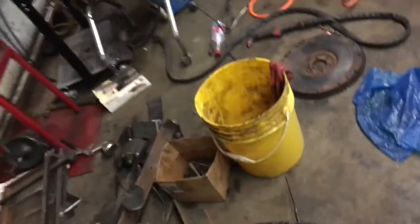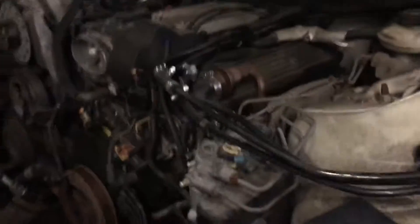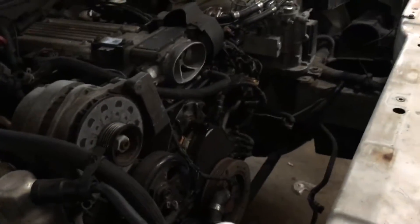I've got a new OptiSpark over here — you see it looks kind of like that right down there on the top of it. That OptiSpark requires a different camshaft, and I believe that's the only thing it requires extra. Also a wiring harness, which I've already got. So I'll just be putting a newer camshaft and lifters in the new engine, and then it'll be basically just like putting this engine right back in, just new.